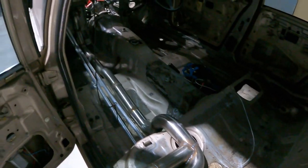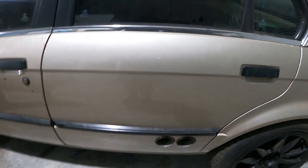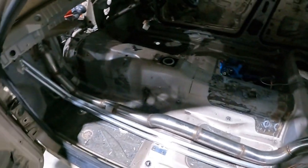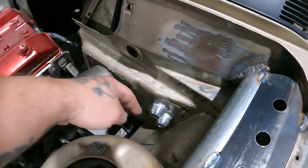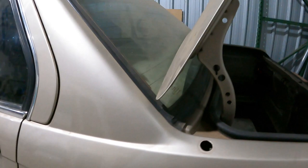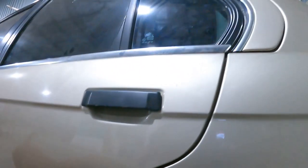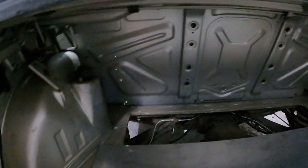Twin three-inch exhaust outlet — shuts perfectly, all mounted up. All stainless steel. The two lines here are for the radiator, so they're a dash-16 line. We need to recess them in just a little bit for that bottom one, but top and bottom will be fine. Dash-16 in and out — doesn't matter which one we use. They run underneath the car, right there, coming out of the car and up on this side here.